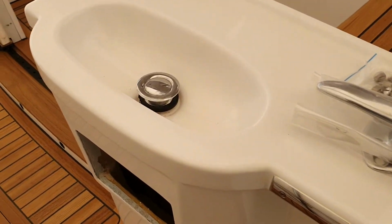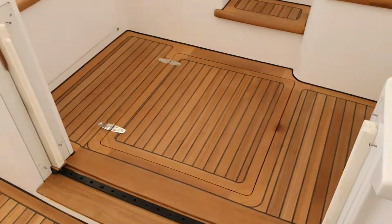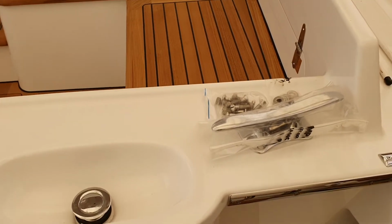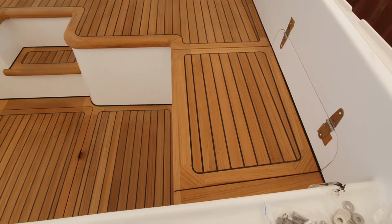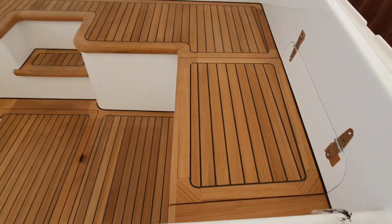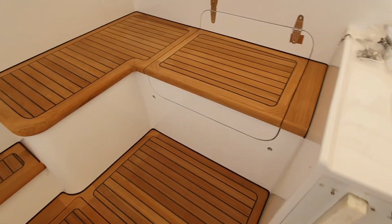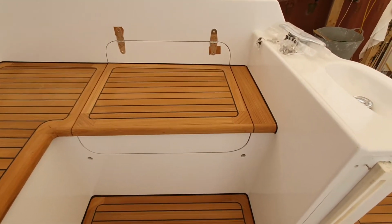I built a mould and made a quick sink up, and that cabinet, I'll put that on the transom. This transom, the opening was actually over where the sink is, and when I started there were no seats in this cockpit, so these seats we're looking along were not there. The one across the main bulkhead there just runs straight out to the hull. So these are all fiberglass moulded, these seats. I made a mould in place and took a mould of the environment and then continued.